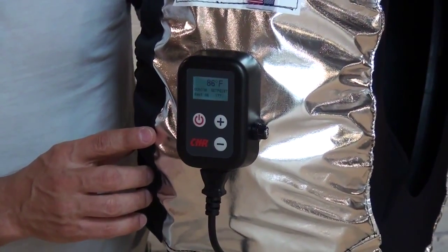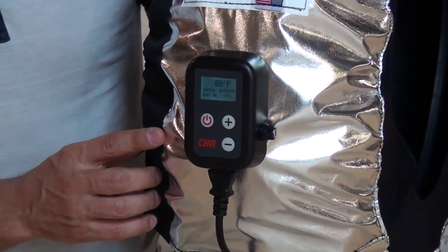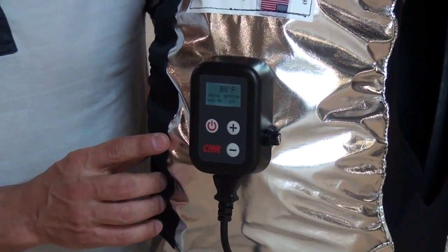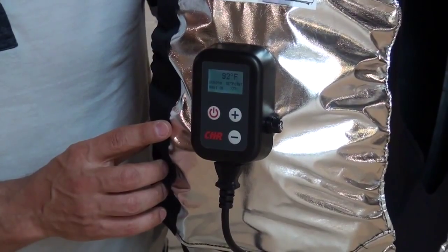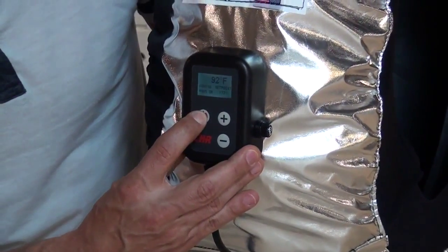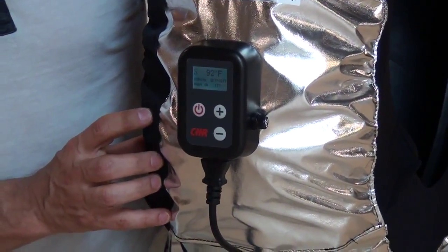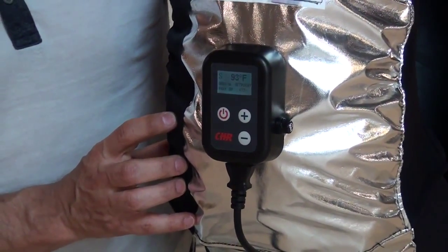General mode gives you the ability to have the tire warmer powered at full power until it reaches the desired temperature, when it will turn on and off as needed. If you are heating up a brand new tire, or yesterday's tire for the first time today, heating it in slow mode will allow a stepped or ramped program, so the tire is heated up more gently for its initial heat up.